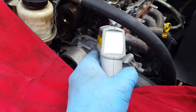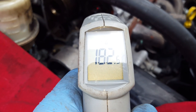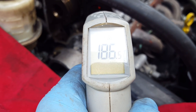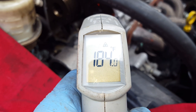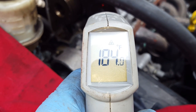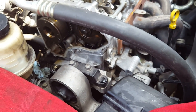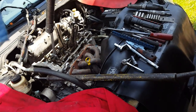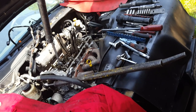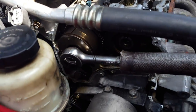I got that one loose. After I heated it up to about 240 degrees, it came loose. At 150 to 175 degrees I couldn't get it loose, but at 240 degrees — waited 10 seconds after the torch — it came free. I've got one wrench on the sprocket and another with a little cheater bar on that 15/16ths. Those bolts are quite tight.